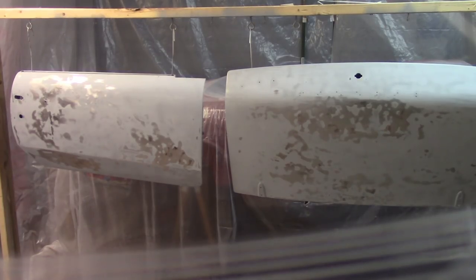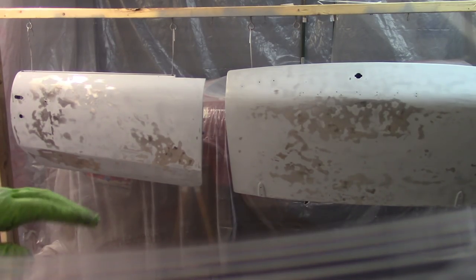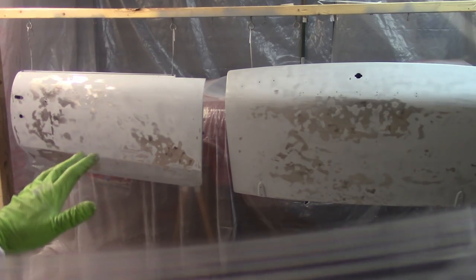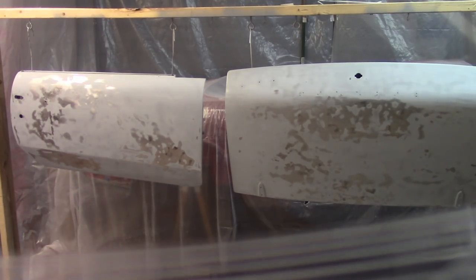Ready to paint coat number one. I've set the camera up in a zip-loc bag so the image is probably not going to be that great. Got everything wax and grease removed — already mentioned that — and then went over everything with a tack cloth. The idea of the tack cloth is to just get loose freestanding dust off the panel. You don't want to rub it too hard on the surface because it is a sticky waxy stuff and if you rub too hard you'll transfer it over to the panel, which would totally defeat the purpose.